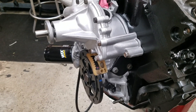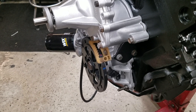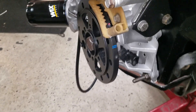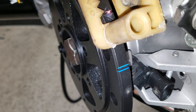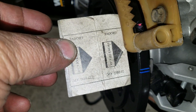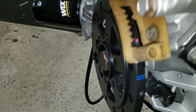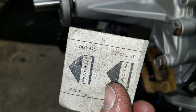Per request, I'm going to put my spin on the subject that's been covered widely over the years of installing the cam sensor. First thing you have to do is rotate the engine 25 degrees after top dead center. You will see that pink mark — that is 25 degrees after top dead center. Here's the piece of paper that comes with the Casper's tool to determine that.